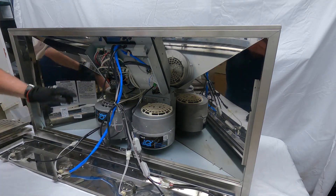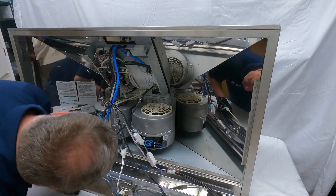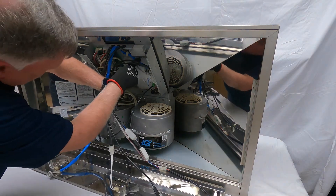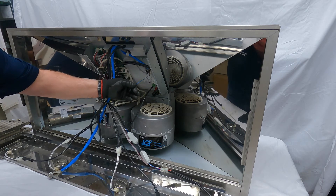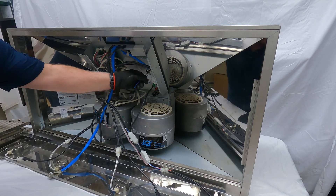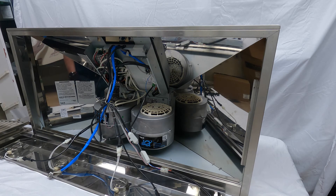The BLDC board has four screws holding it in — two on the bottom and two on the top. The electrical assembly is located right here. There is a screw here holding the electrical assembly, and there'll be a screw on the bottom. The whole electrical assembly comes out — it's all plug and play. Here is the antenna. This unit has remote control capability with RF frequency, and this is the antenna that makes the remote work with this unit. It's pretty basic; you can get at everything. It's a good hood to repair — there's not much to it.